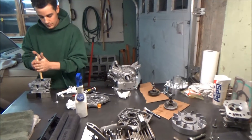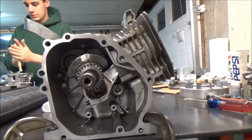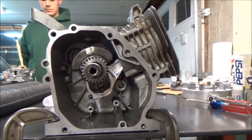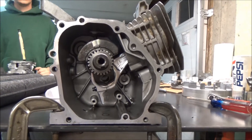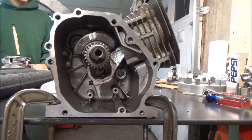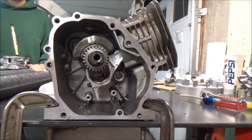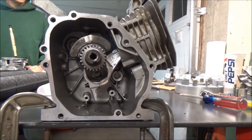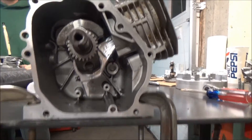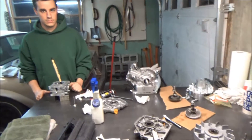Just wanted to let you guys know where I'm at on the GX. I just finished torquing down my ARC rod — it ends up torquing to about 150 inch pounds, but they have a very specific way to do it. ARC is really great and they send a set of directions, so that's all set and ready to go. I'm going to get to lapping my valves and we'll check in with you guys later.